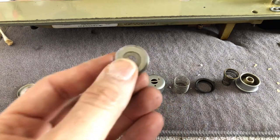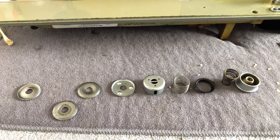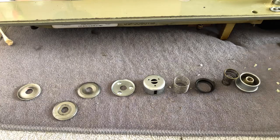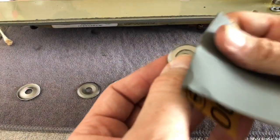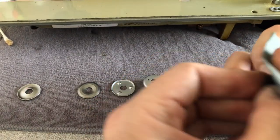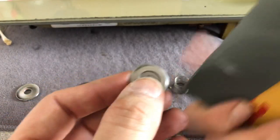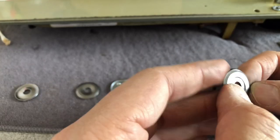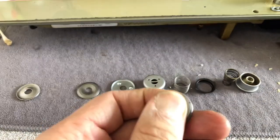Don't go by the color alone because you can have a stain in the finish even when it's smooth, and you don't want to keep grinding until you remove the stain — that's not your mission here. The goal is just to get everything smooth so that when the thread comes through it doesn't hang up. The last thing you need is thread getting caught on a burr or a cut in the steel, because if you do it's going to mess up your tension. It's not really common to have damage to such things. I'm not sure why this one has that little spot, but we're going to finish up. This is 2000 grit — really low abrasion but enough. You always start with whatever grit you need and go coarser to finer.